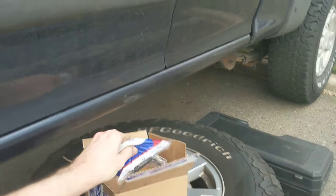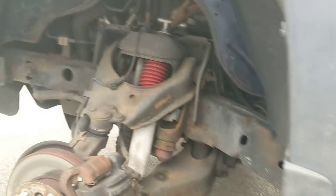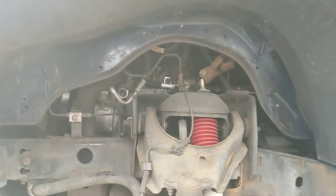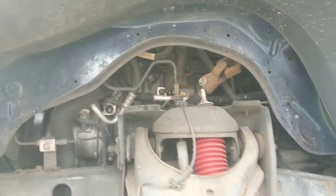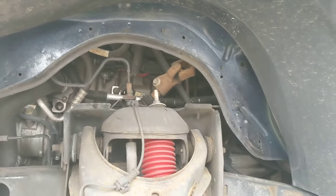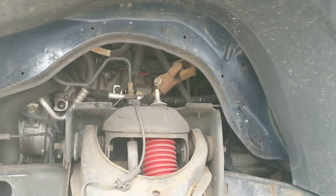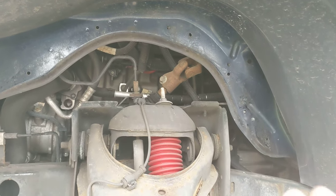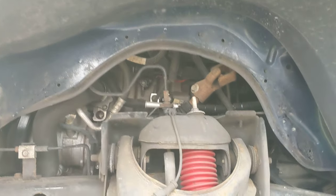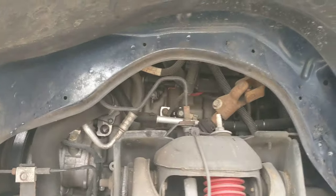The reason I'm replacing this component is because I'm getting an intermittent P0442 check engine light on the vehicle and also an occasional misfire. As part of the emissions control system on this vehicle, the gasoline vapors in the fuel tank are brought back up through a vapor canister system and returned to the intake manifold where they are re-burned to reduce pollution.